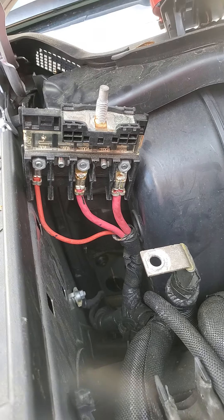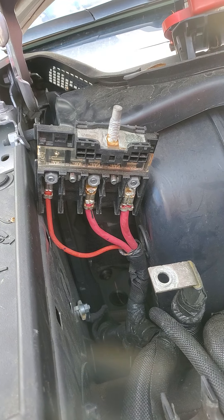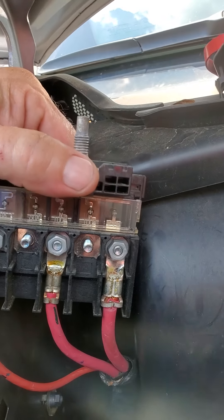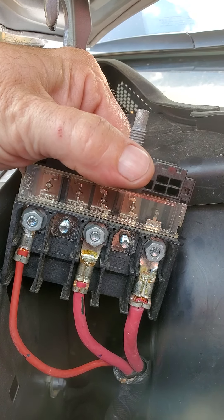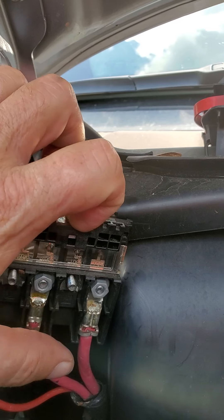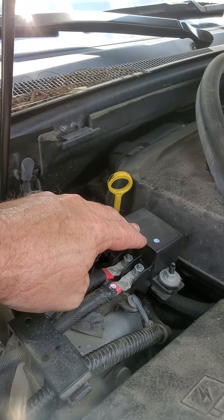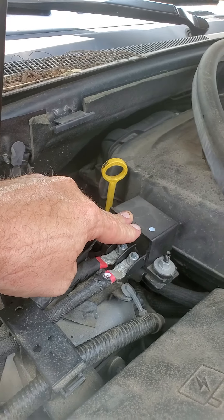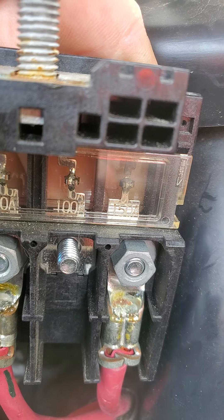Following the wires with a wiring diagram, one of the first places they go is right here — this is your jumper post. Underneath the jumper post, hidden very well, are some fuses. These fuses control how that little battery charges. It comes up from the main battery — you get 12 volts here — then it goes through all this and out through a power control relay, which determines if we're charging that little battery or not. As you can see, my fuse is blown.